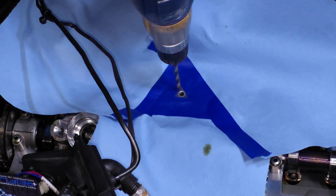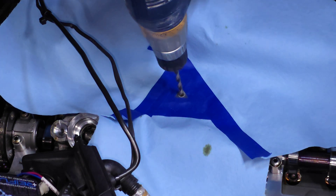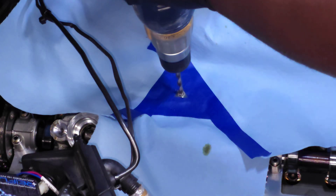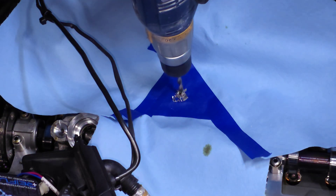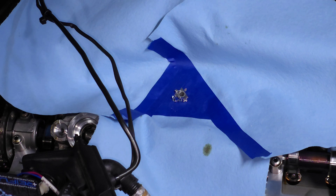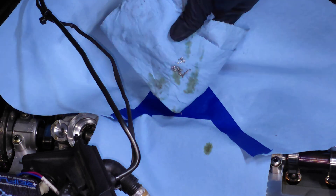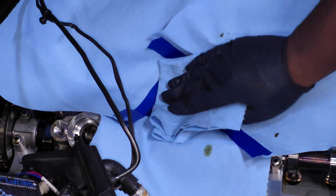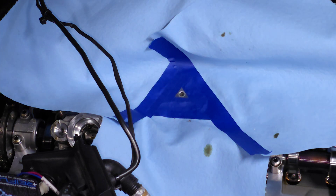I did this by hand. I was able to get it in there pretty straight since the first half of this hole had no threads in it anyway, so it kind of allowed me to start it. Then after it got started, I just turned the drill slowly. You can see all the metal shavings coming out. Once it bottomed out, I reversed and drilled it back out. Now we've got metal shavings everywhere — what do you do? What I like to do is use a shop rag. If it has a little bit of oil on it that also helps. Just pat it down to get most of the bigger metal shavings. They'll stick to the shop towel, and as you lift it up you see all the shavings stuck to the towel. Don't wipe — if you wipe, you might push shavings into the hole. Pat it, and as you pick it up the shavings come with the towel.